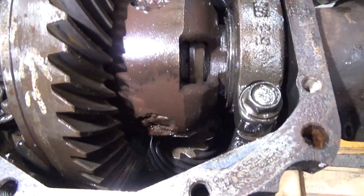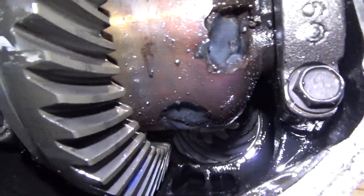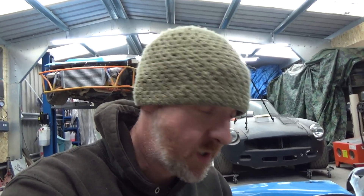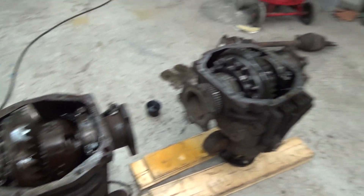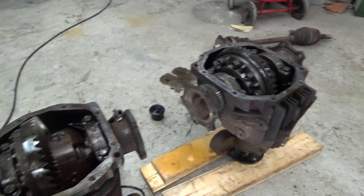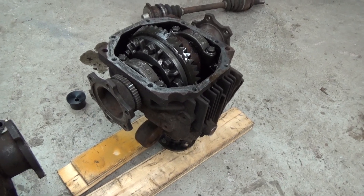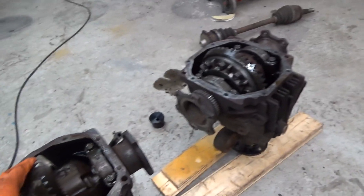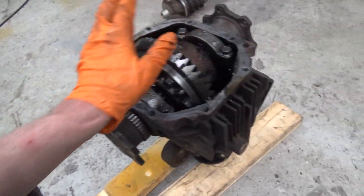I'm not pulling these apart since both work and I want to keep them that way, but it does seem like you could swap the internals around and run different ratios — though I'm sure it's not that easy. The main point is that the gears appear to be the same strength, so if you were blowing up the internals on S14 R200s, switching to a 350Z diff probably isn't going to fix that — the weak point on the 350Z isn't the gears, and I'm hoping my weak point isn't going to move there either.